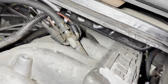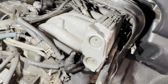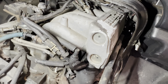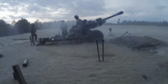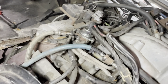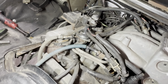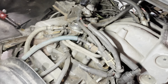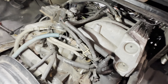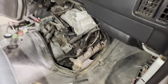Found a couple other vacuum leaks at one of the ports right here. Apparently they had used little wooden golf tees to plug up vacuum lines — that wasn't going to work, so I put vacuum plugs on there. I parts-cannoned a fuel pressure regulator because of all the debris I found in the fuel pump and fuel filter. I pulled off the regulator — it appeared to be okay — but since this is a parts-cannon diagnosis I tossed one in there. We've eliminated the fuel system as the issue.